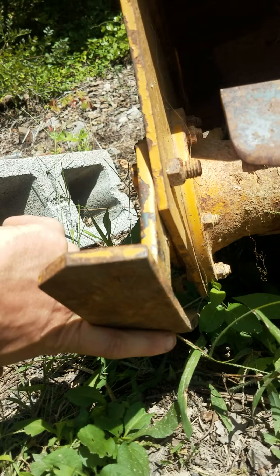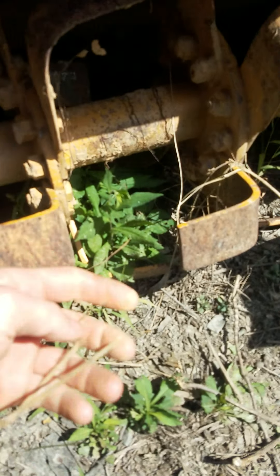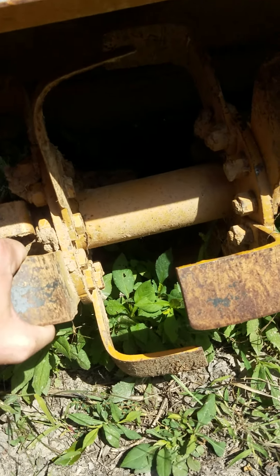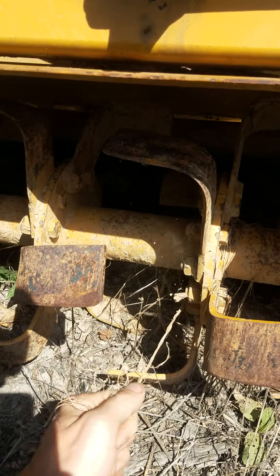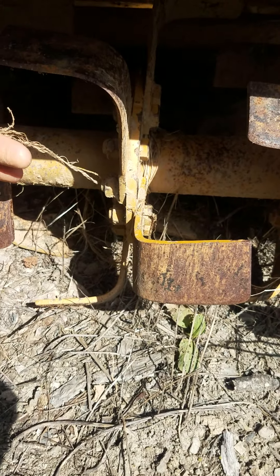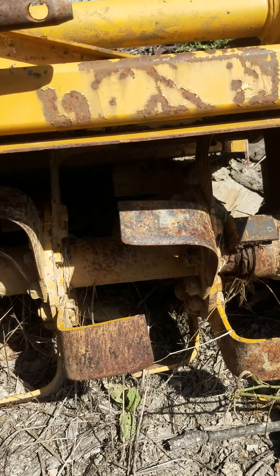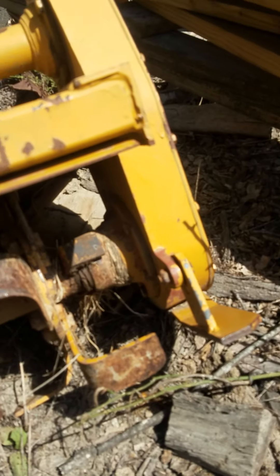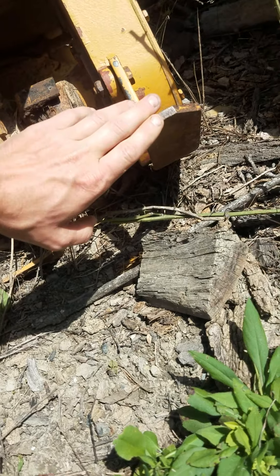Look at the wear shoes — see if they've been dragged across really bad stuff. If they have, there won't be any paint left on them at all. As you can see, there's still yellow paint there. Check along your rail, look to see if they cleaned it out, check how tight things feel, make sure nothing's loose. Check to see if there's baler twine or something. Right here you have a little bit of twine — that's okay. On the end you have a little bit more twine. If it's big gobs of twine, watch out because it's probably sucked into the bearings on each end.